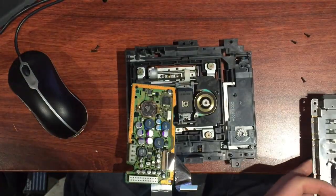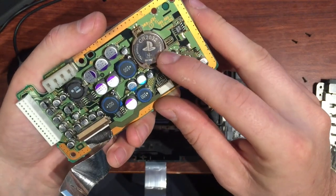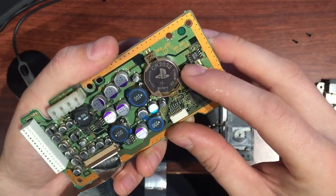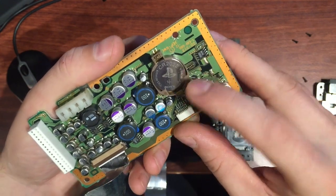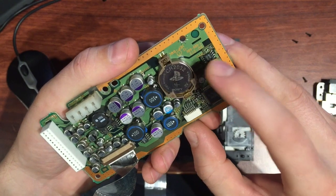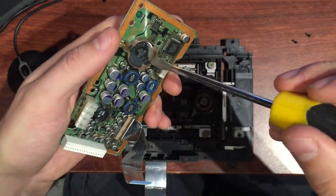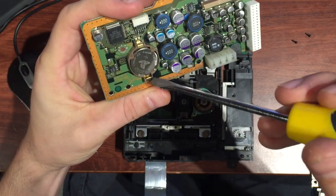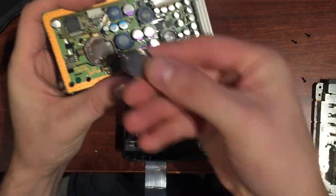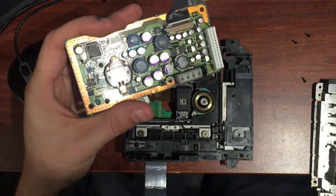While we're at this stage, we're obviously going to take the opportunity to swap the battery. This one's actually a Sony-branded battery with the PlayStation logo on it — that's crazy, I've never seen that before. Sony must have got their own batteries stamped — or I guess they make them. Most other consoles have a Maxell or third-party brand in there. This is a simple coin cell holder — it should pop out from this end by sliding it back. Just caught that before it fell on the floor. As long as it's a CR2032 — which I've got plenty of — we'll put that in.